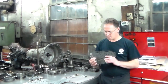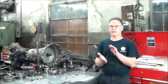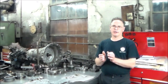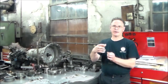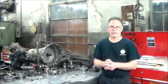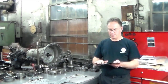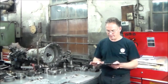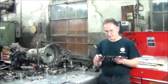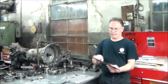I want to give you guys a close-up shot of this. When you put this transmission together — the main case and the bell housing — you seal it with silicone. Even when you put the back cover on, which has the stator shaft that feeds the reverse drum and the high drum, that has silicone as well, and so does the auxiliary valve body. I'm rubbing my fingers across this plate, and I feel something. I start looking at it, and this is a pinhole — I don't even know if you can get a pin in here. There's a piece of silicone stuck in the feed hole.